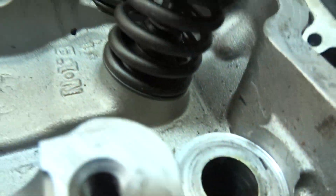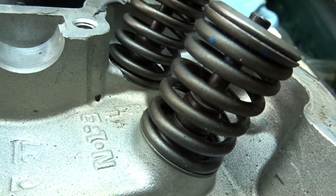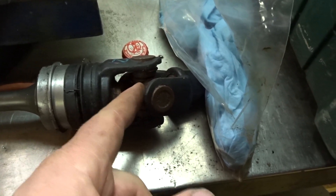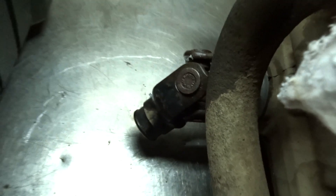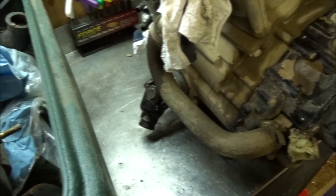If you look inside here in those springs you can see the valve seals that we're going to be changing out — not in this head, but on that one. Also this U-joint is quite a bit better than the one on here. This one has a lot of play, so to save myself some money we're going to take this one out and put it in there.